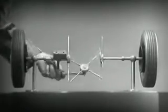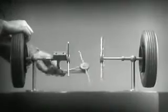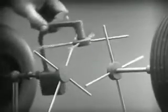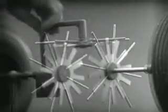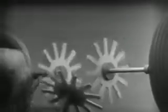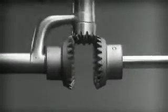Now we have the working principles of a differential. To adapt the model for use in an automobile, we will have to make a few changes. In order to reduce the jerky action caused by wide spaces between the spokes, we will put in more spokes. Further filling in the spaces between the spokes gives steadier, more continuous action. And changing the shape gives firm, constant contact. Now we can make the gears thicker and stronger. And we have differential gears.